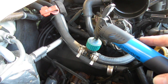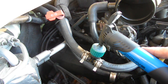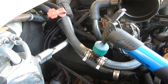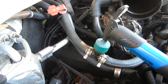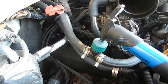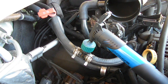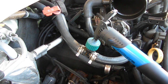Then you just pump it a few times — it doesn't take much pressure, it's a pretty low pressure system, but it won't take much to show you where your leak is. I'm not going to do it right now because I've already drained all the coolant out in preparation. I was able to pump the bicycle pump a few times and give it enough pressure that the leak showed up — it's leaking right there at the passenger side front of the intake manifold gasket.